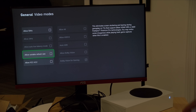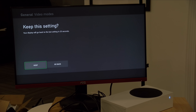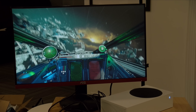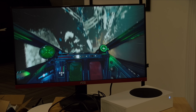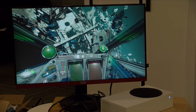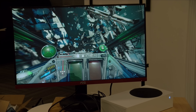On the gaming side, I plugged in my Xbox Series S, which can work with variable frame rates at up to 120Hz. I plugged it into my gaming monitor and it was able to successfully negotiate that FreeSync was enabled on the display. A game I play on the Xbox that runs at a varied frame rate worked out just fine. My display doesn't give me real-time statistics, but the Xbox was able to switch itself into that mode successfully and everything got detected properly.